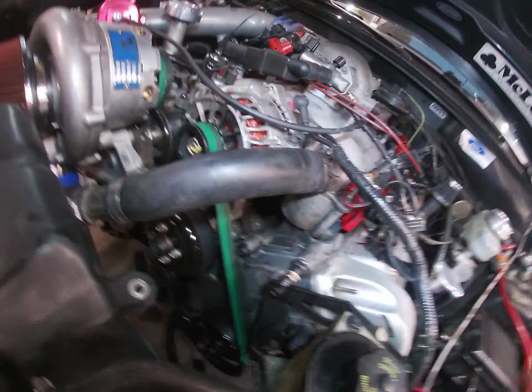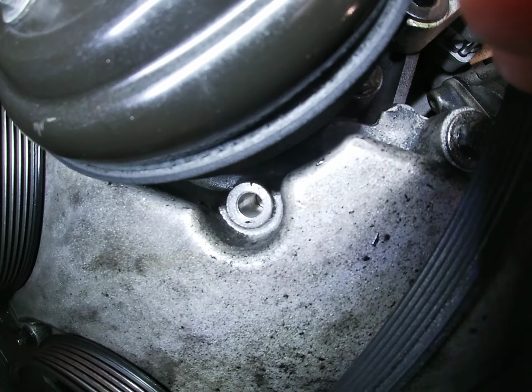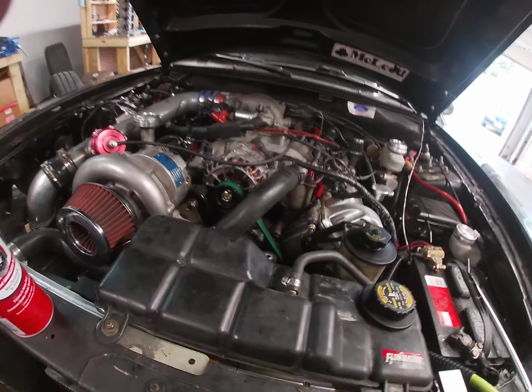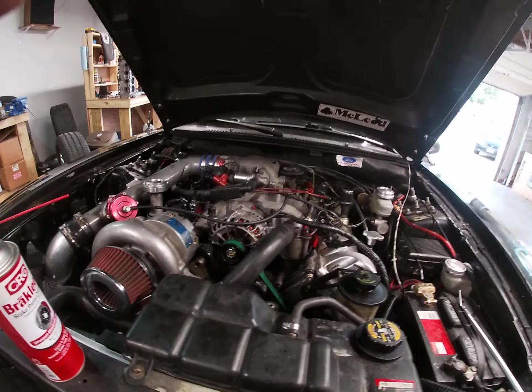So there's a little bolt hole right here on the blocks that I have. You can't use that bolt hole. As you can see, there are no threads in that hole at all. So what we did on my other block is we siliconed it real good, and I completely forgot. That is my bad. But we found that, so I'm gonna get her all cleaned up with brake clean, clean out of there, let it sit overnight. Should seal up, shouldn't have any more oil leak issues.